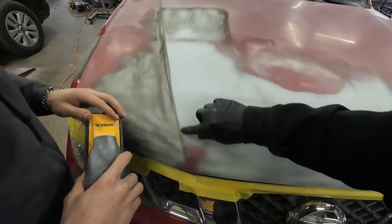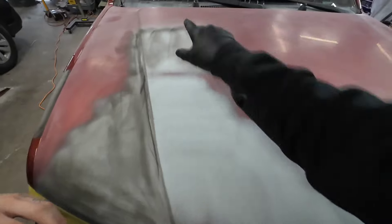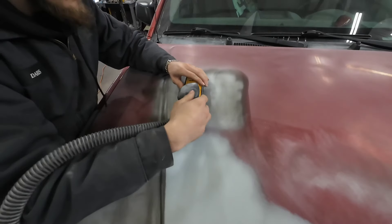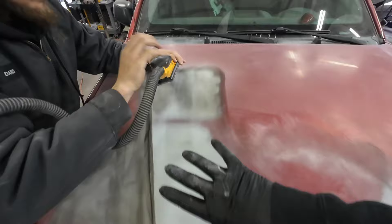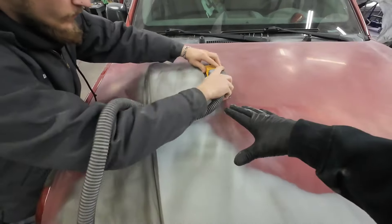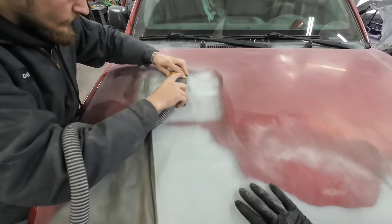See how that disappeared — now it's nice and straight. This is what you want to do when you're repairing your vehicle or doing a restoration: make sure all your body work is straight. Block out the primer and that'll get it laser straight and ready for paint. This feels good.